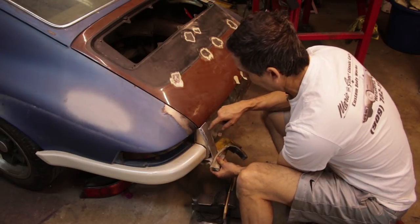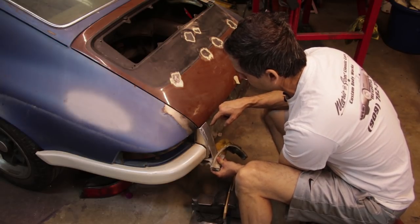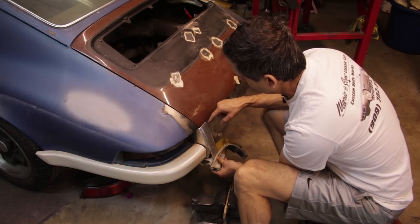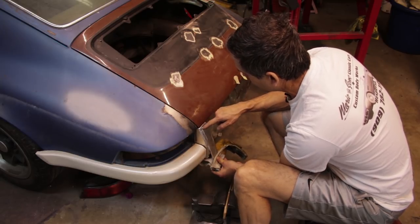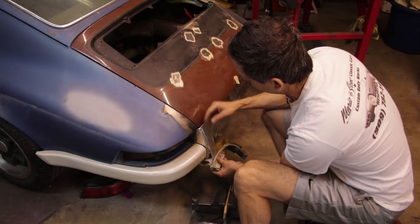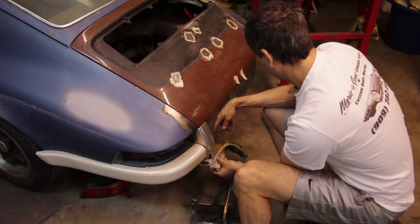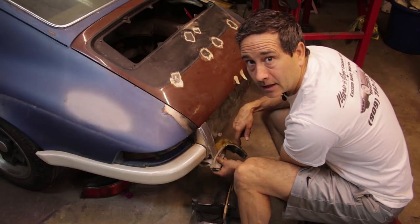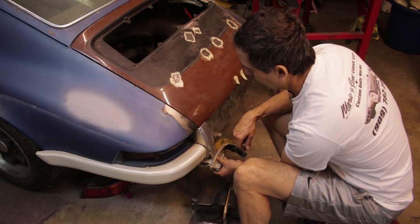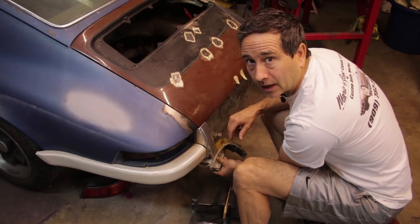I've been constantly checking the fit of the parts relative to the car just to make sure things aren't getting distorted and completely out of shape. Right now it's looking pretty close. This part at the top needs to be trimmed, but I am getting the right level on the deck lid and it's still fitting tight against the license plate panel. It's still really hot - I just have to let it cool down and take my time, but I constantly come back and check it on the car for fit.